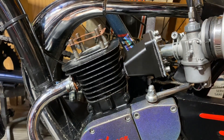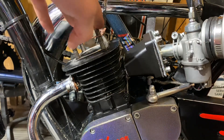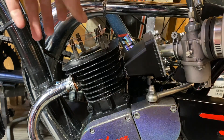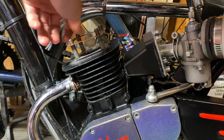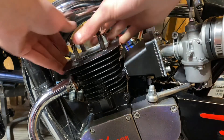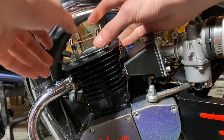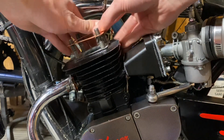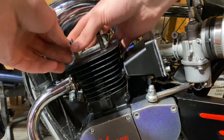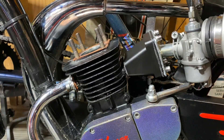When installing one of these gaskets, the crucial thing is to work it on carefully. What I recommend is to take two nuts and tighten them together on the stud, then back off the stud a few turns — this will allow the stud to be more pliable, and then you can tighten them right back up after. You can see the stud now has a little bit of play in it. Then thread by thread we're going to install this head gasket. If you bend it, it'll seal but not very well, and once you start getting high RPMs it may blow out. See how it dropped on super easily? That's what we want.